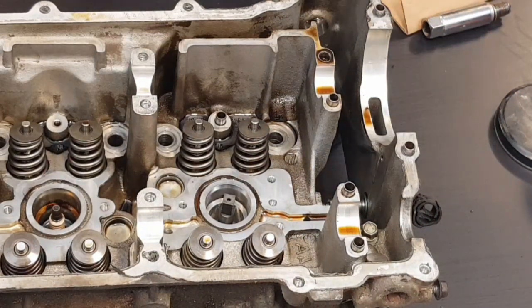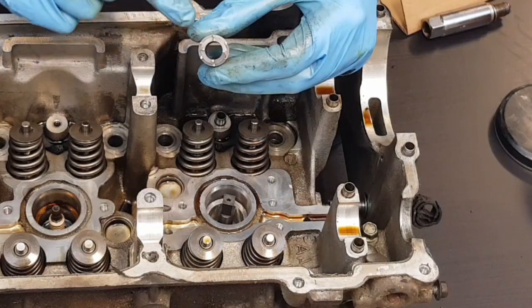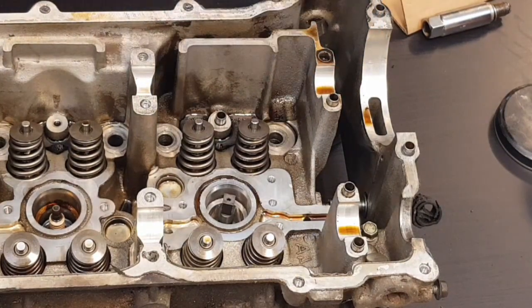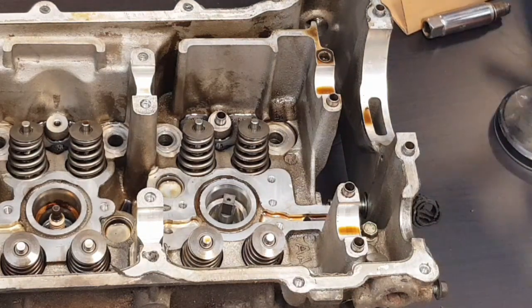The new thread is now cut. I've now got to cut the recess for where the insert goes in, and also cut the new seat for the spark plug. I'm going to put a bit of grease on the end of the seat cutter.